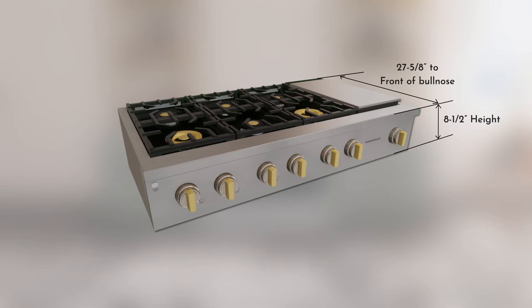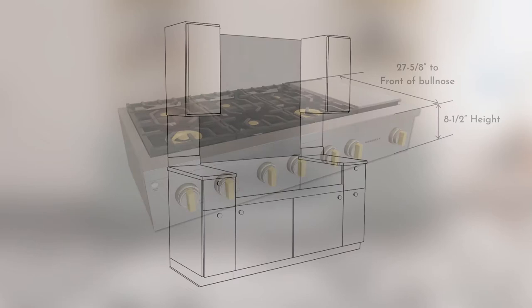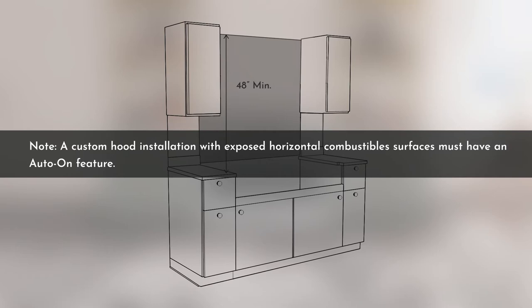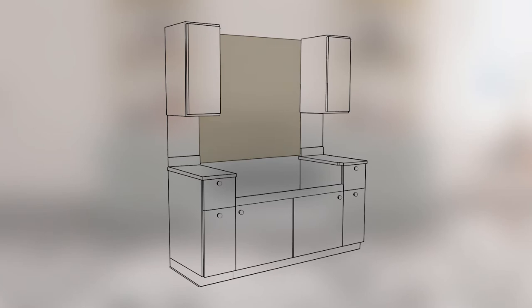Installation of the range for all models without a hood requires a minimum of 48 inches to combustible materials. Note that a custom hood installation with exposed horizontal combustible surfaces must have an auto-on feature. The entire surface of the back wall above the range and below the hood is to be covered with a non-combustible material such as metal, ceramic tile, brick, marble, or other stone.